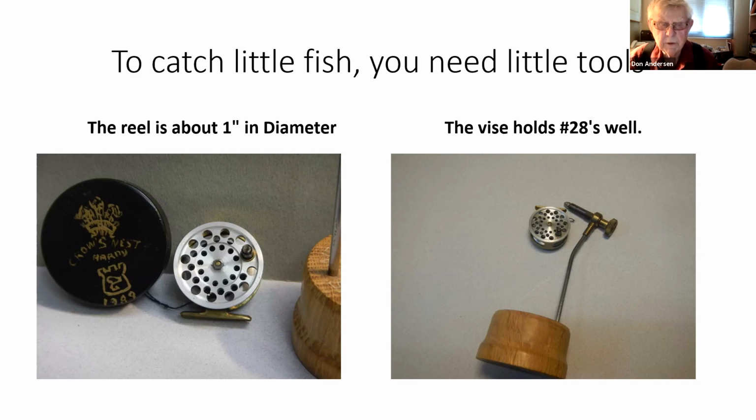I always remember him showing me a spark plug that was about 3/4 inch long and about 1/8 inch diameter. And I asked him how he built it. And he said, well, I machined the metal out. Okay, that makes sense. And then to build the insulator, it was built of UHMW, and used a stainless piece of wire, Monel wire. He actually drilled through the center of the UHMW to build the electrode for it.